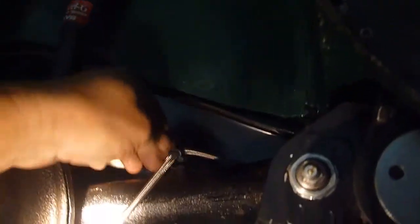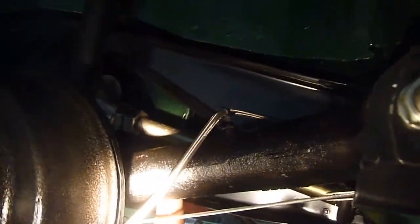Okay, you can. And then what I've done is normally that would be a flexi pipe to here, and then a metal pipe. But these are complete flexes, and all I've done is just tie wrapped it to there over the top. If you put it underneath, it's going to get caught on the handbrake cable, and they're going to get pinched here in between. So anyway, this will be the last one. What I've done now is I've made this brake line up, and the line's not actually attached. This one's in, and this one is. And what I was going to do was actually make a flare for you, so you can see.